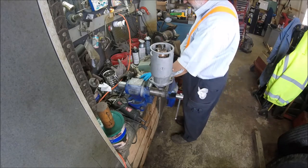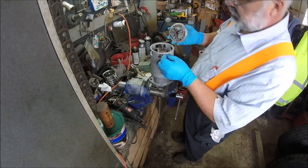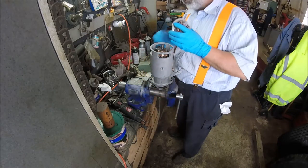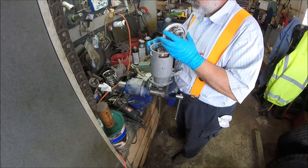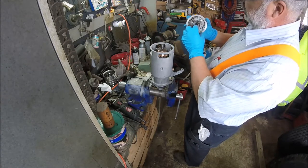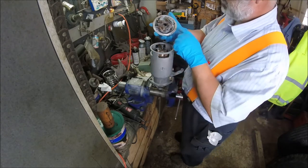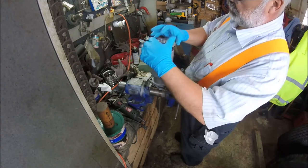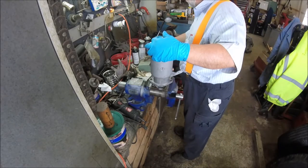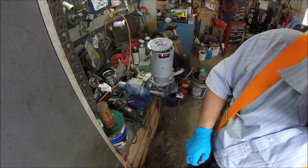Picture our nose and decide which way this goes on. You have two contacts here, one on this side and one on this side, to go into these contacts on the end of these stator windings. I left the screws in so I wouldn't misplace them, so the first thing that needs to happen is they need to come out. These brushes all need to be pried back so they can go all around the outside of that commutator, all at the same time as you try to get this thing lined up. There's a pin in this as well - it puts it in the right place and lines up the holes for the two bolts that hold this whole unit together. I'm going to switch you over to the other side.